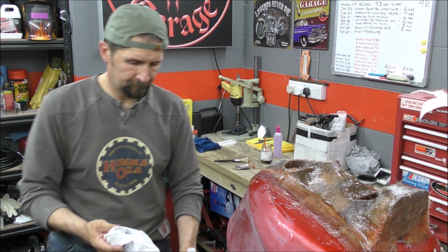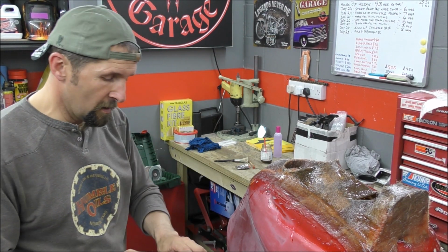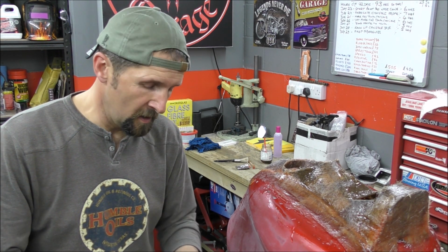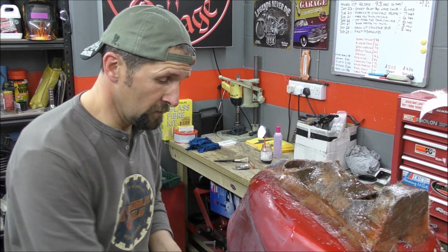Right, okay, now in real time that was 3.5 hours just since I put it on the bench and put you above it. 3.5 hours, little bit by little bit, laying it up. There's about 3 full thicknesses now of fiberglass on there, and it is a heavy duty fiberglass. You may have noticed it's not the thin tissue stuff, it's pretty rough, and it will do the job.